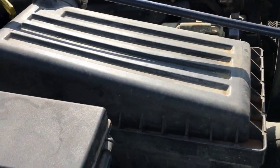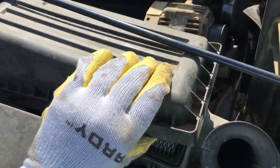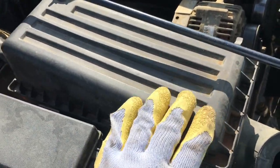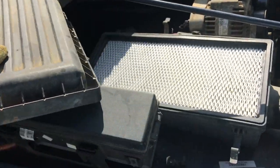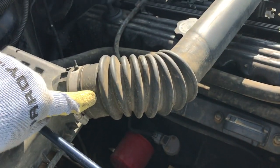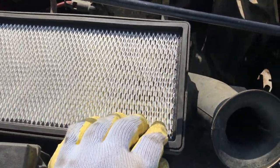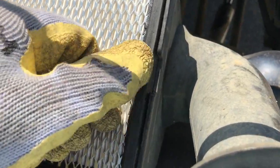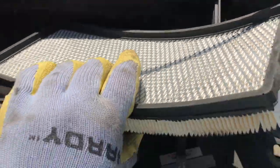Next, let's go to that air filter. Since I've removed all the clips off the air filter just by popping them loose, next is to figure out how in the world you get this thing off because it's kind of cumbersome. The trick is when you lift this air box off, just tilt it slightly and slide it back. That flexible hose on the air intake system isn't there by accident — it's there by design so you can remove this. Then you have full exposure to the air filter itself. You're gonna want to remove the air filter; if you notice at the ends they have a little tab for you to put your finger in, which allows you to grab the air filter a little bit easier than manipulating it from the sides.